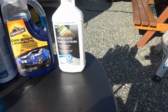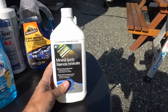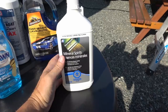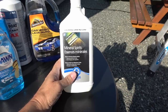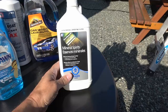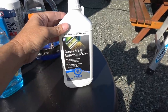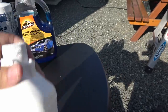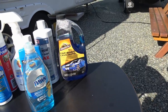And anything that was really hard — some places where rubber had stuck or road grime — the final option I use is mineral spirits. You have to be pretty careful with that; especially on the rubber roof it's okay to wipe it away quickly but you don't want to leave it pooled because it can cause problems. Another option is acetone for the rubber roof, but I find mineral spirits is pretty good on the fiberglass if I'm trying to get a really tough stain out.